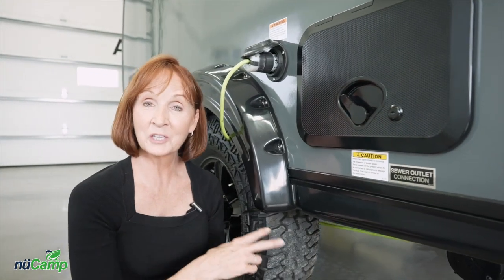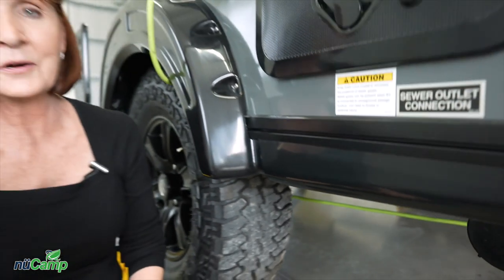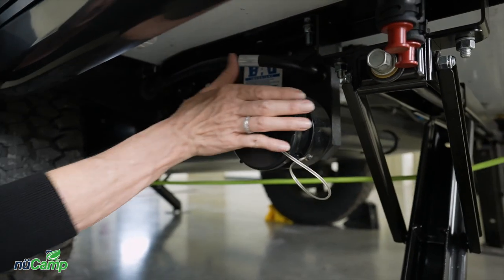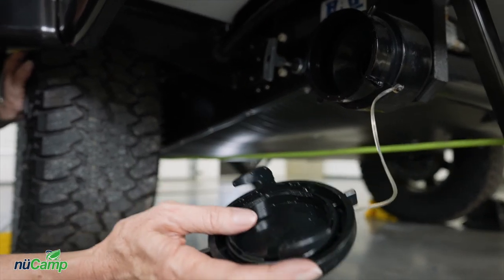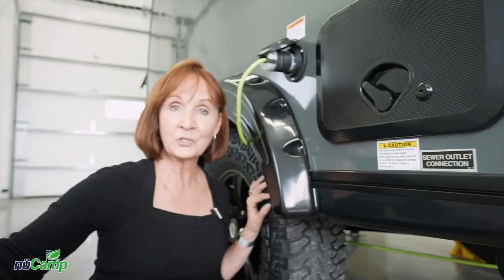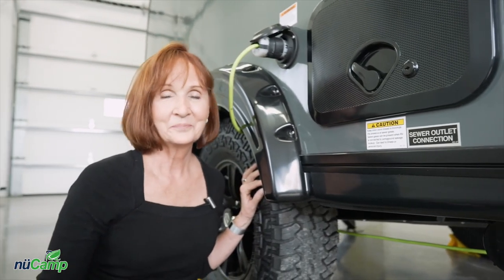Underneath the Nautilus system are the low point drains and the sewer connection. You can see the low point drain knobs right here — those will help drain the lines if you're trying to winterize or just keep water fresh. To the right, the sewer connection is a gray tank pole where you connect the sewer hose. Take the cap off — you can see the bayonet fittings right here; you'll see those same bayonet fittings on the sewer hose. Connect the hose so the knobs on the pipe are locked inside those hooks. Connect the other side at the dump station or campsite and pull this gray tab straight out. Push it in when you're done and reattach the cap. Very simple.